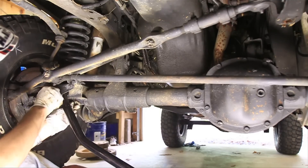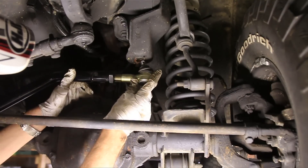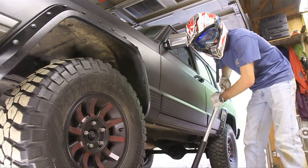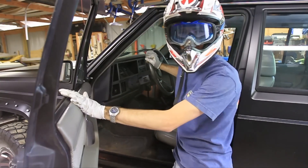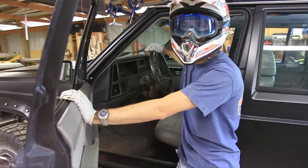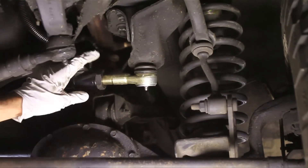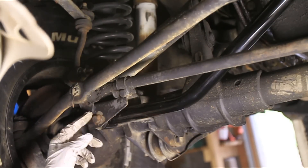To put everything back together, start by fishing this through and putting the axle end in first, then hand tighten. If the body still needs to move over a bit more, you can enlist some help, use a ratchet strap, or if your sway bar is disconnected you can jack up the passenger side. By far the easiest way — only if you're very careful — is to have somebody turn the steering wheel momentarily to line everything up while you get it in there. Once it's on, torque it down to 35 foot-pounds and install the cotter pin. Add a bit of Loctite to the jam nut and tighten it to 55 foot-pounds, then come back to the last one and tighten it to 45 foot-pounds.